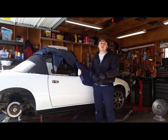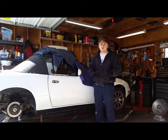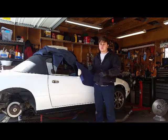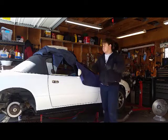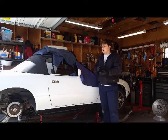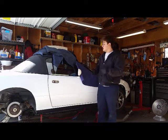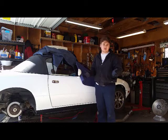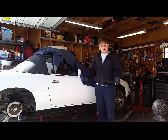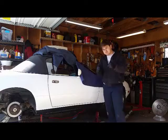With all of that, basically we're going to be getting ready for boost. I'm not going to go high boost nor high horsepower — I'm aiming for low 200 wheel horsepower. I'm hopefully going to go with an MK Turbo kit. Right now I'll be installing the return line in the oil pan, just because it's easy when the engine's out and I have the oil pan off — just a couple things that are going to make boost a little sturdier and longer lasting, to make sure that my engine doesn't completely hemorrhage oil while under boost.